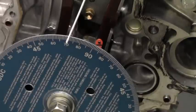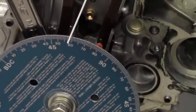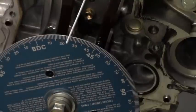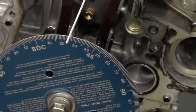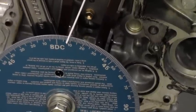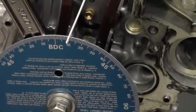As these increments go along, we'll take this 50 thousandths at a time and the intake valve will be closing. On the closing side, we are at — let me look at your view — 25 degrees before bottom dead center. Another 50 thousandths on top of that will give us 10 degrees before bottom dead center.